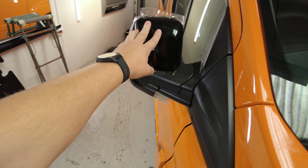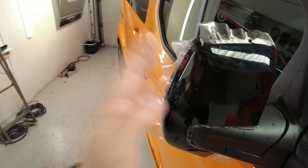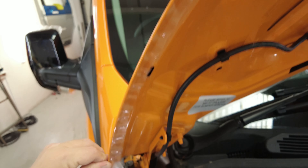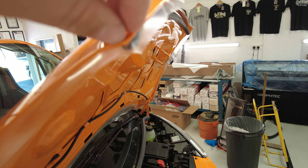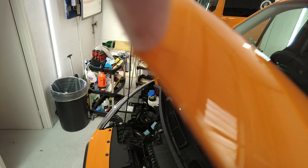I've just put that wing mirror on, started wrapping it around, just allowing all the edges to dry out. I'm trying to get the main body of the mirror on because it is quite complex and curved. I could put it in two pieces, but I'm not going to — again, trying to keep it a clean one-piece look all the way around this van if I can. For the bonnet, I'm going to start wrapping around the edges, but I'm not going to cut on the underside yet — I'll allow it to dry and bond first. If you see here, there are two points — if I was to wrap all that around, there would just be too much material bunching underneath and it would end up letting go. So what I do is put a small cut across as close as possible to the edge, which relieves all the tension. Underneath, there's no material actually on the corner, which is going to prevent it lifting. For the longevity of it, it's the best thing to do. I'll do that on all the corners if it needs it.